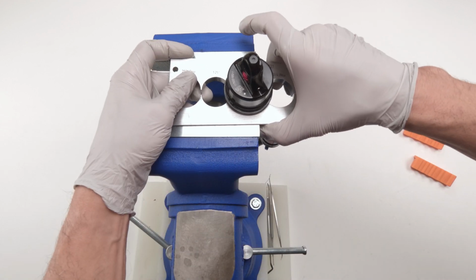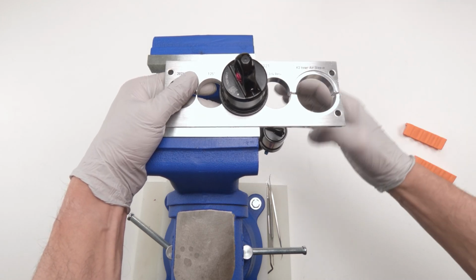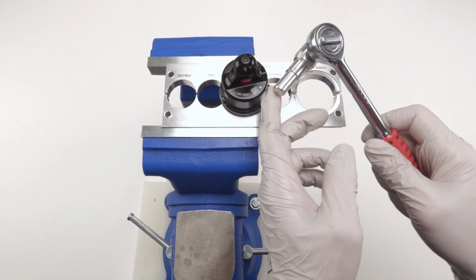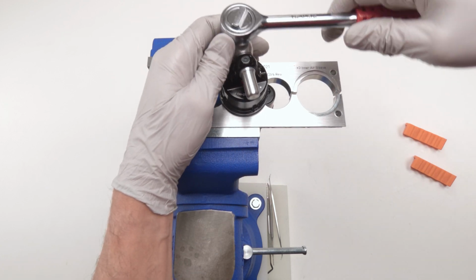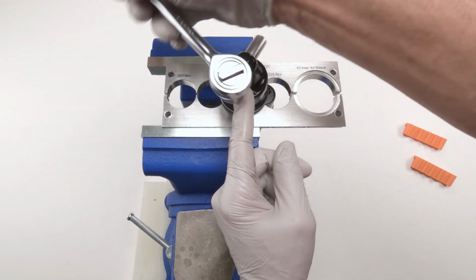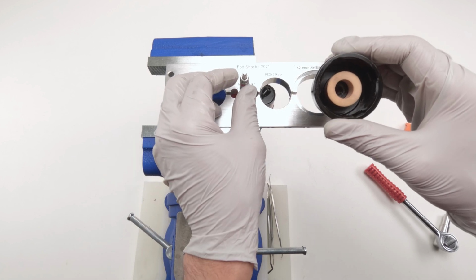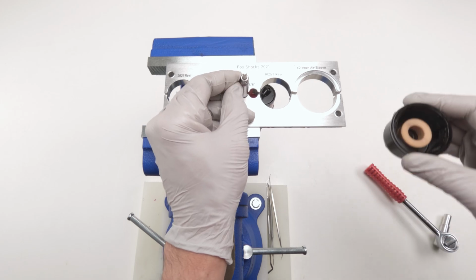2. Put this guy in. Careful with them. Squeeze them together. Let's make sure we got good enough grip in there. And don't over tighten them. I have an eyelet removal tool, but you could use a wrench, you could use a Knipex, just try not to mar them, right? So I'm going to put this guy in here, and there we go. You're supposed to hear those clicks as he's unscrewing out. That's totally normal. And then boom, there is our top cap. And we're going to leave everything intact as is, although there is Loctite over here we're going to clean up later before we put more Loctite when we close it back up.